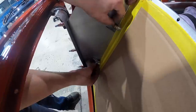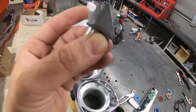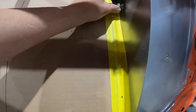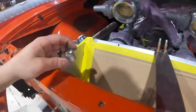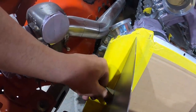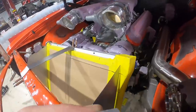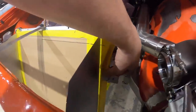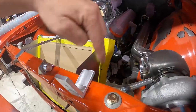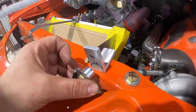We have our little radiator tabs cut — this is what you want it all to look like when it's done. All you have to do is put it in place, weld the steel part, weld the aluminum part, and you're good to go. On one side, because the core is big enough, I'll put it down low right there. On the other side I'm going to use a piece of angle on the outside of the intake — weld one surface to the intake and then weld the bung to that surface.